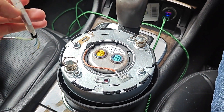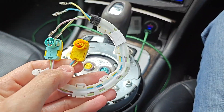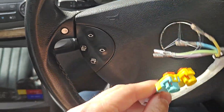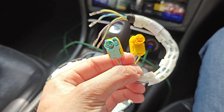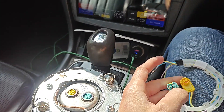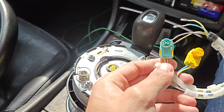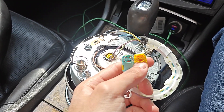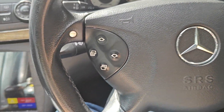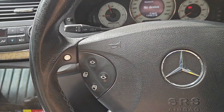We have to do a couple of things first of all — obviously remove the wheel, put the new wheel back on, then solder these connectors here. Luckily, Mercedes keeps the wiring the same colour, even though this is 20 years older than this wheel. So green and purple, blue and yellow will get soldered to the same wires respectively on here, because the connectors on the 211 wheel are about this long. Since there's not much space in that hole, I'd rather just use the connectors intended for the airbag on here. It's just a safer idea to solder these to the SRS module — I'll take the wire harness out so there's no voltage from the soldering iron potentially going to the SRS module, which could cause havoc. We don't want that.